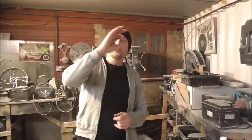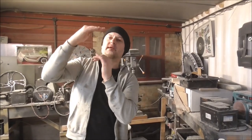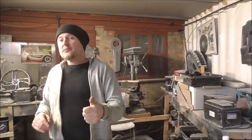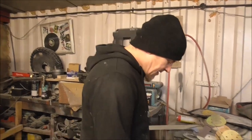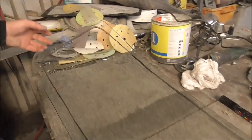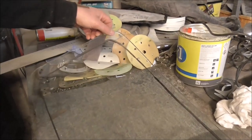The first thing we're going to do - if you remember that fiberglass rebate we made the other week - we've marked the glass up to the rebate in the window and we're going to take that as our minimum mark. We can't go any more than that to show a bit of rebate, so we'll probably move the line in a little bit. The line's marked, let's get to blacking it in. I'm going to mask off a border all the way around here, but I'm not going to mask just to the line of my rebate - I just cut the rebate out with the angle grinder.